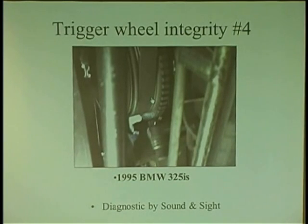I mean, how often do you come across that? But someone put the wrong size tires in the front and the back, and created a problem. And it was on a Cadillac. I'll never forget, it was on a Cadillac. If you ran the car, it got to the point where the ABS system was telling the ECM to shut down the car. You couldn't drive it. It was electronic throttle. I couldn't drive the car anymore, and I got this traction light flashing.